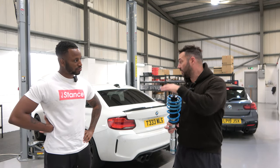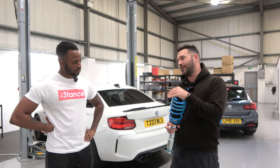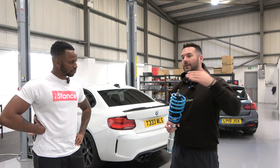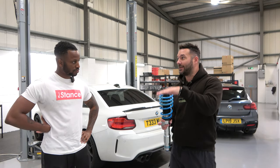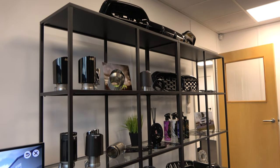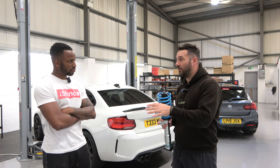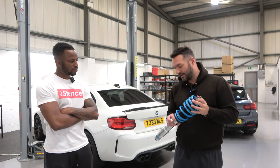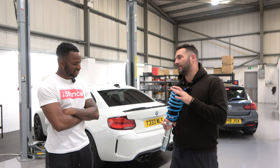It's not just about controlling ride height — you want to get some damper adjustment, which gives you a bit more control on rebound. When you're at speed and hitting a bump, you really want to get that car as level as quickly as possible. The standard dampers struggle a bit with that, especially when lower — they're fine for road, but for quick tracks you're going to need to upgrade.